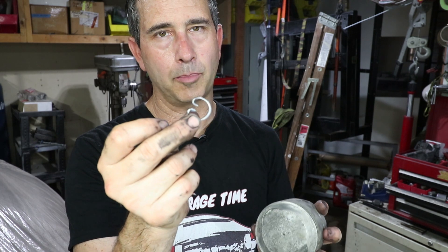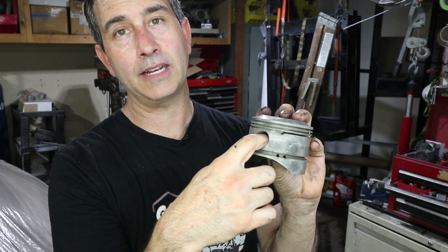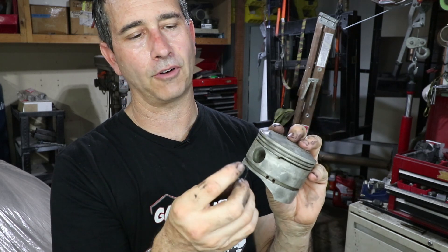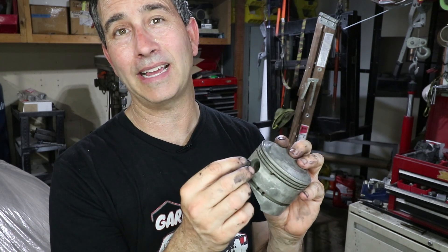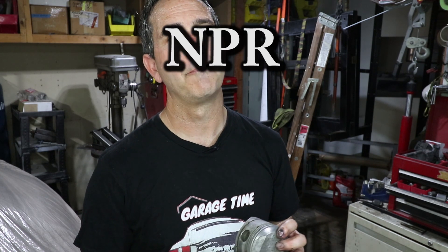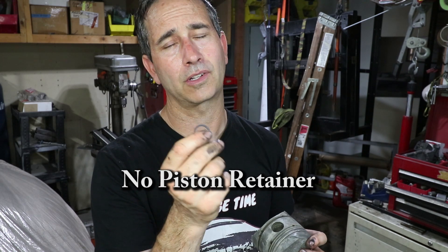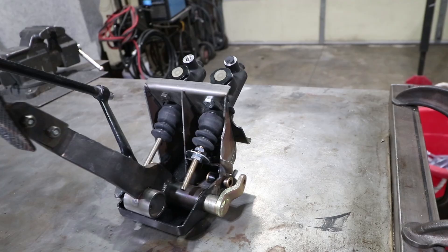If you're not familiar with where this little part goes, it goes right inside this hole where the wrist pin supports the piston onto the connecting rod. These are little locks that hold that pin in place so it doesn't slide around and damage the bores. It's an important piece, and these are vintage pistons. The pistons I'm using are NPR and they are no longer available, and I don't believe these circlips are available either, so I'm going to need to find some. Fingers crossed I can locate my own; if not I'll have to reach out to see if maybe you guys have some on the shelf.